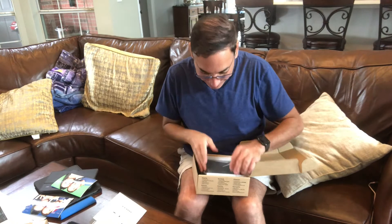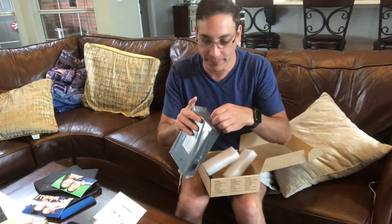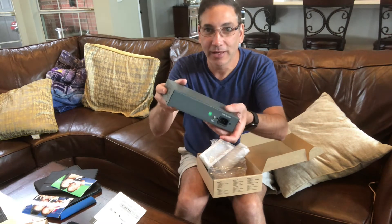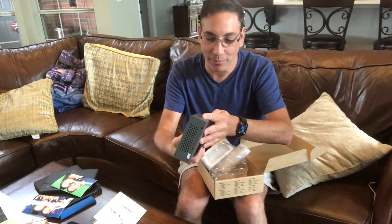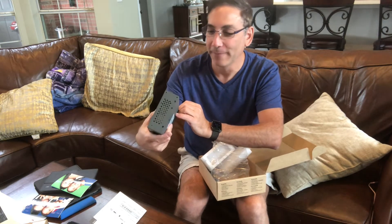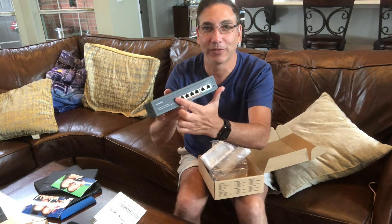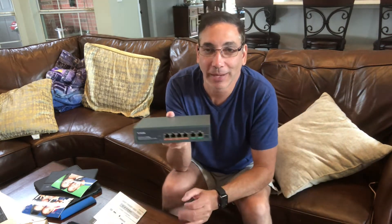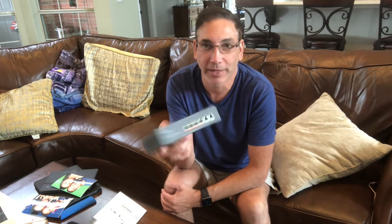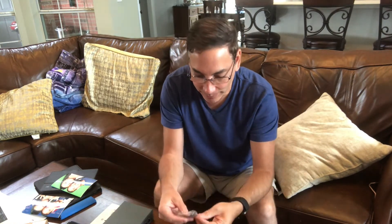It comes here in the box wrapped up with protection. It's definitely not a rack mount one — it's just a standalone unit. It's got a metal box on it. It's got the AC input in the back and all the different ports on there. You can see it's got a couple of uplink ports and 10/100 megabit ports for the other ones, so it's not a gigabit switch, but for cameras around the house a hundred megabit is more than enough — it would even handle a 4K camera.